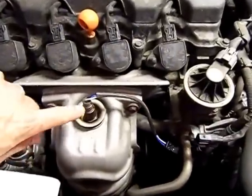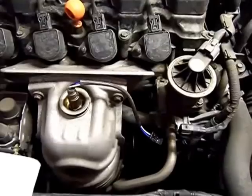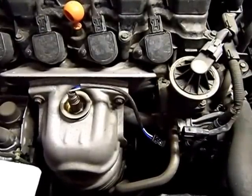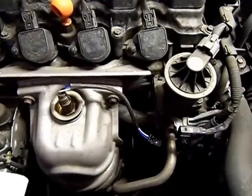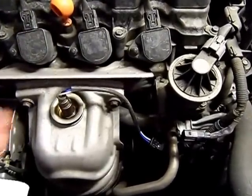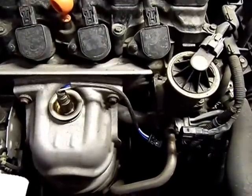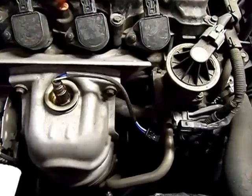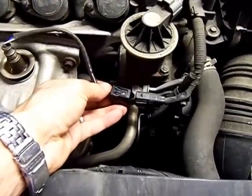This is the upstream oxygen sensor here. Our gas mileage went from 34 down to about 27, so I called my brother, who's a mechanic, and he recommended replacing it in the absence of any check engine light. We did this one about 30 or 40,000 miles ago, and our gas mileage has tapered off again since then. So we're going to swap this out again just to see if it fixes the problem, because it's an easy fix for a $100 part.